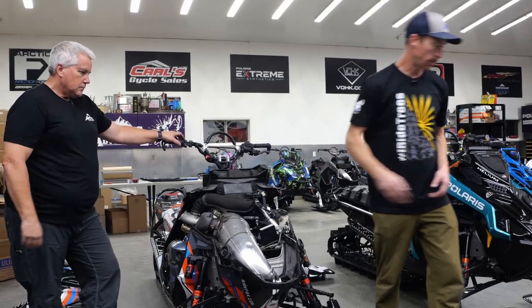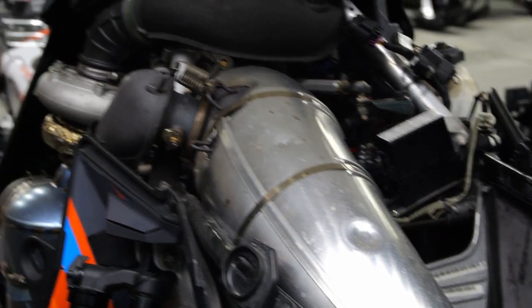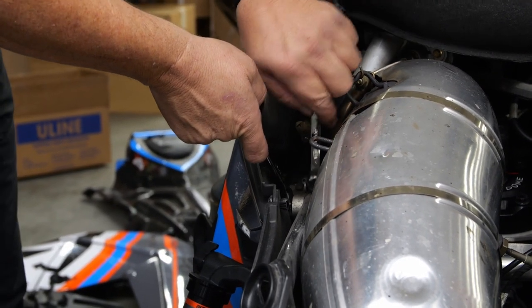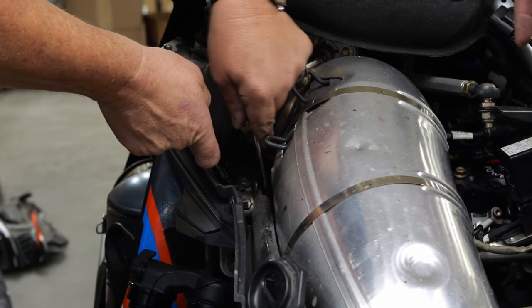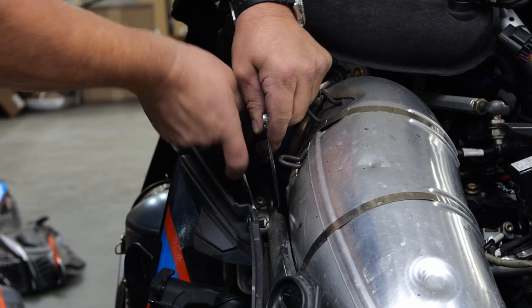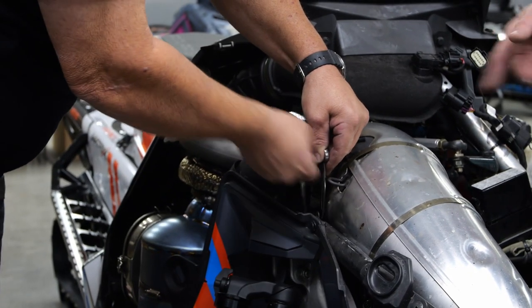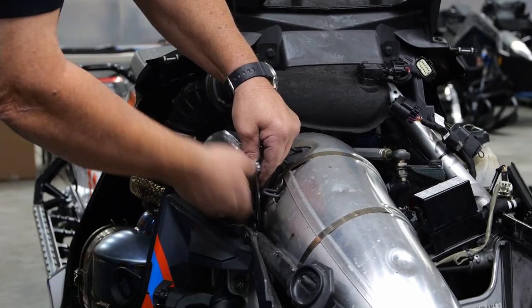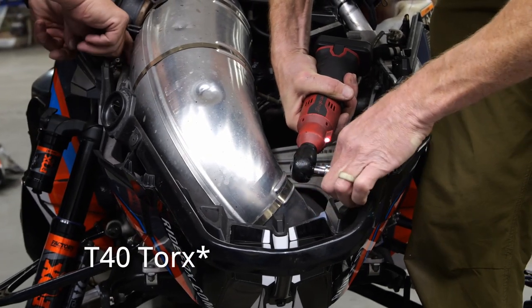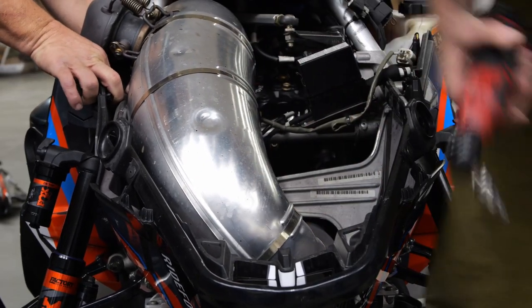Belt guard off. Now we're going to take our couple fasteners here and get this front bumper off. Jeff is going to take the spring off — you want to make sure you don't drop that down into the chassis. Then we're going to take our two 10 millimeters. The key is to loosen up the nut side versus the bolt side, because there's not a ton of bolt head sticking out. He broke the bolt loose on the nut side of the bolt versus the head side. While he's working that, I'm going to get these two T45s out.